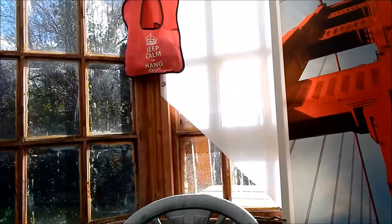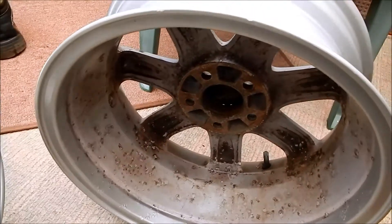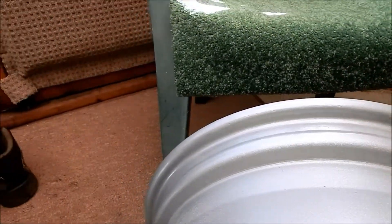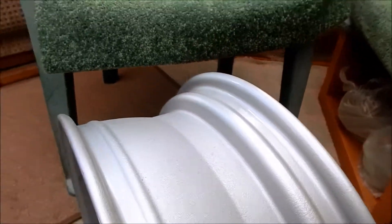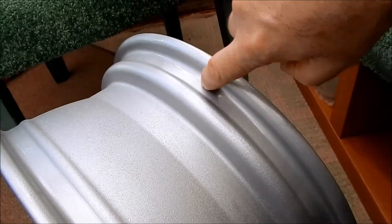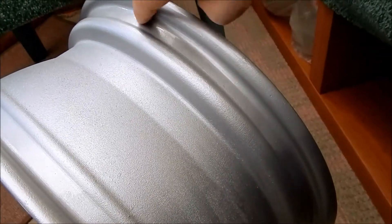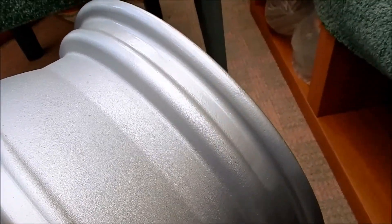It's a nice sunny day, and I've got the rims in here to cure the paint — it's just aerosol spray paint out of a can. The bit where the corrosion actually matters is here. You get sandpaper, you take the tyres off — I went to a local tyre shop — and you take the rubber off the rims, then lay it on a table outside and keep sanding with a very coarse grade, strong wet-and-dry paper, until the corrosion is gone. It'll be quite hard because it's anodised aluminium with crusty road salts and a reaction that forms.